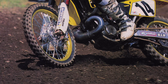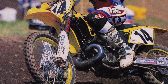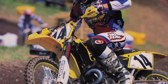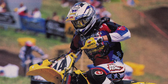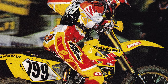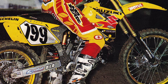Also playing into this hyper personality was the RM's new motor. The redesigned power plant provided a hard-hitting, quick-revving style of power that spooled up fast and blasted the machine out of every corner. The motor's light flywheel made it incredibly responsive to throttle input, but there was less traditional grunt down low than in the YZ, KX, and KTM. Most of its power was situated dead center in the mid-range, and the RM was incredibly quick once it hit the meat of its power band. Top end was rather unimpressive, however, and it was better to shift rather than try to scream it out of every corner.